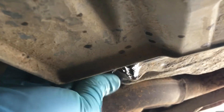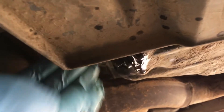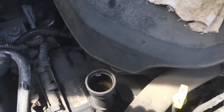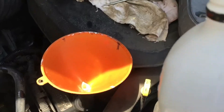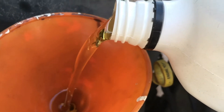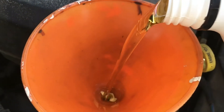We're back under the car and by this point you can see the oil is just dripping, so we're just going to screw the drain plug back in, snug that up with the wrench, and then fill the oil. Open up the oil cap, put a funnel right on there, and pour the oil in. That's the color that oil should be — oil is supposed to be honey colored, not black. Look at that nice fresh oil.